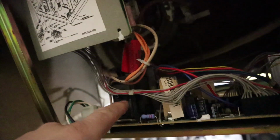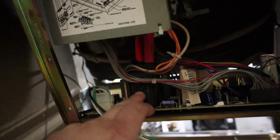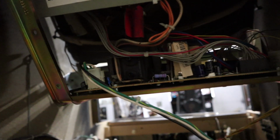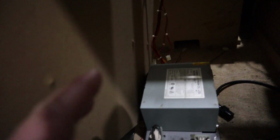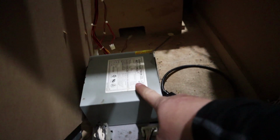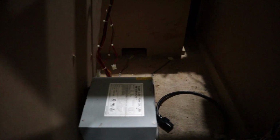But to pull this flyback off, it has this goofy plug up there, and to pull that apart, I got to de-energize it, because this thing has basically like a super capacitor, and it has juice in it, even though it's been unplugged for could be unplugged for years supposedly. Now the other problem I got is this power pack. You saw the one I just showed you. They put that in because this went bad, so they put one alongside it. But basically this is bad, so I'm going to change that out.